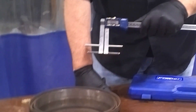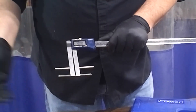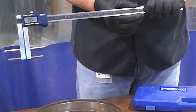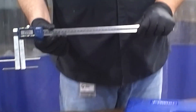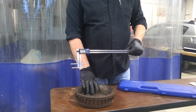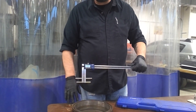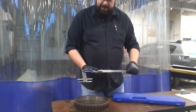Like the other digital caliper, we want to pull from right here. We also want to make sure this bar right here is free from dirt, debris, grease, oil, or anything — it will give you a faulty measurement. Double-check your measurement when you take it. If you know you're working with a 6- or 7-inch drum and it's reading 14 inches, you have a problem. You probably want to clean this beam off and take another measurement. If you're still having issues, definitely take a hard look at your equipment.